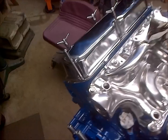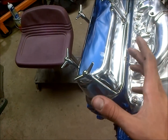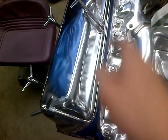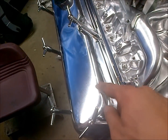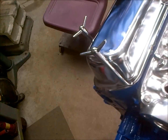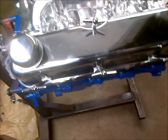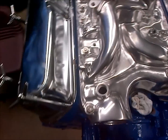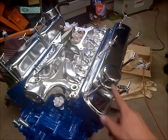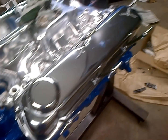So we've got our new valve covers on here — there wasn't much to show on how to do that. All I do is take the gasket, set it in the cover to make sure I have the right side. It's a cork gasket with little locator plugs. I coat the side that mates with the cover with gasket sealer and press it against the valve cover, then run the cover down and on. There is a torque spec for valve covers, but really just don't over-tighten them — let the gasket do the work. Most people don't torque their valve covers, especially with wing bolt style covers.